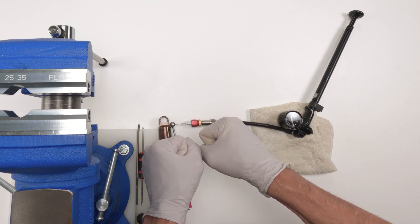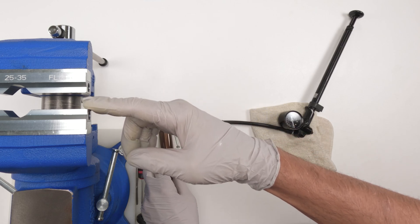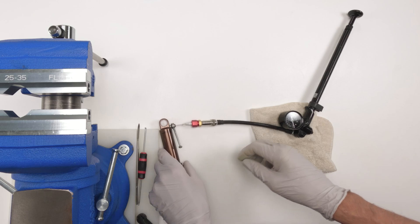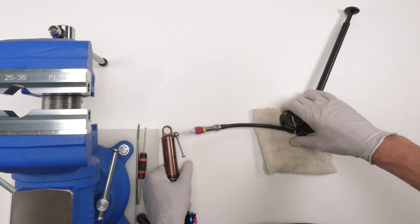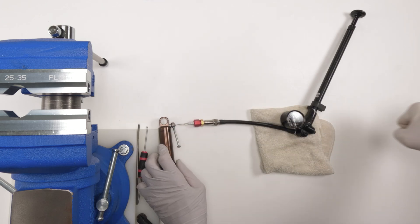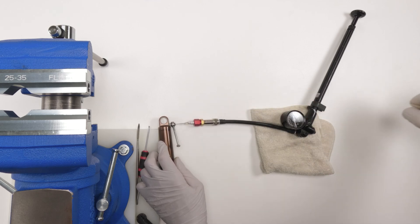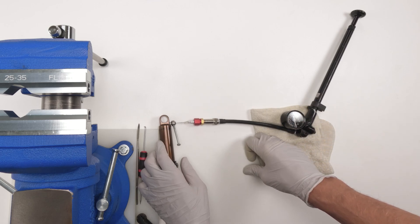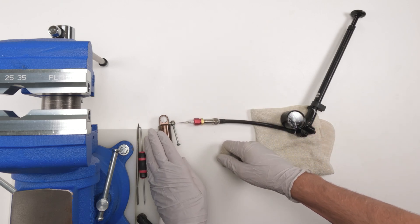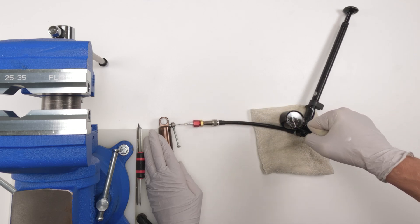The problem is pulling the needle out becomes very tough. So you're going to need to use some really good force to pull it out — that's the only negative about doing it on the ground as opposed to having the shock in a vice and pulling the entire pump up to create the separation. What you'll need to do at the end, when we're done filling it up, is get a good hold of the shock on the table, then get a good hold of the shock pump and pull it straight out as hard as you can. Just make sure you don't stab yourself in any way.